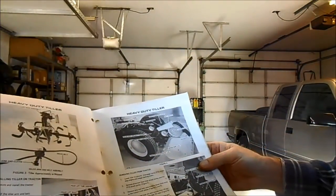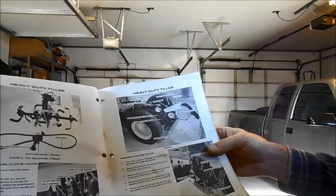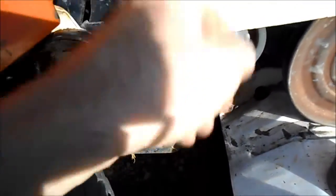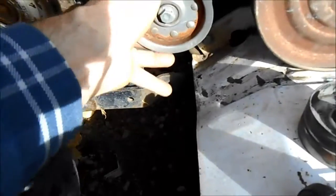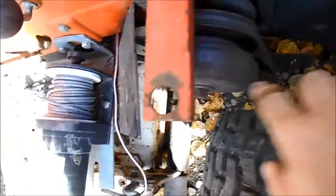Okay Tubes, this is the setup. This is that idler pulley I was telling you about. Now that spring will stay tight. The belt comes down like that, across the top, around and up and through, and then over to the front. Around the top, around the PTO drive, back through there and around.